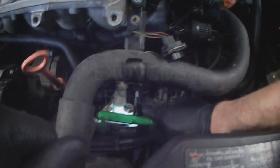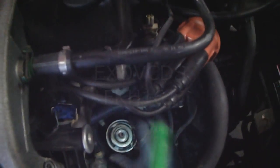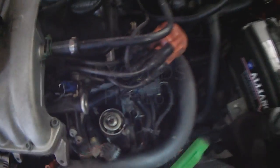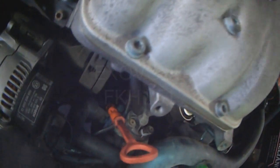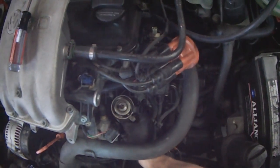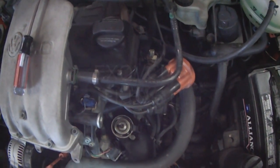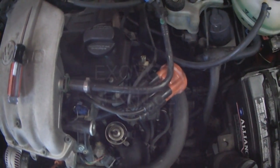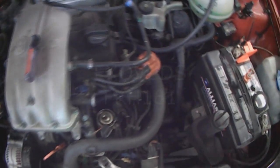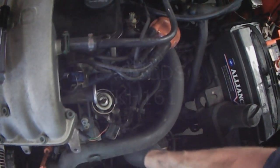You can see even this white mark lines up, and it is pointing at number one — though slightly off as it was before, which is fine. Then it's just a matter of putting the clamp back on and putting things back together. The 2.0L does not need to have timing checked at any specific RPM — as long as the rotor is pointing to number one, the computer will take care of the rest.